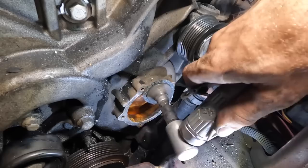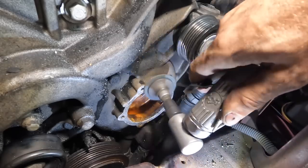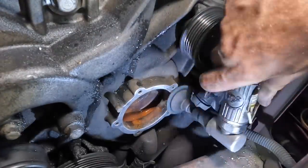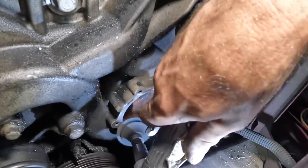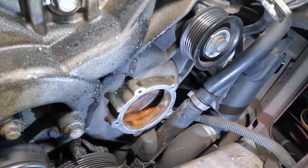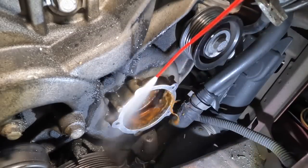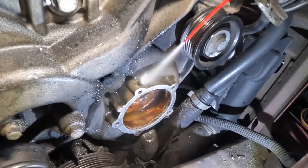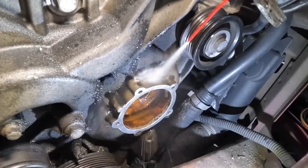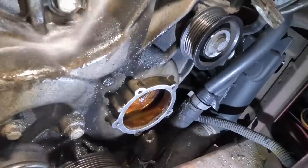We're good — it's actually damaged so we're not going to do that. We're going to get rid of the corrosion. All right, that's looking good. This gasket surface is clean, it's free of any debris now. Let's get rid of the really small particles. Ew — rusty coolant, that's not okay. Coolant is not supposed to be made out of rust, we don't like that. Goodbye grease.